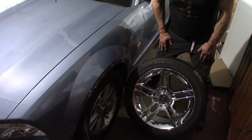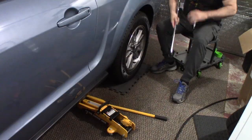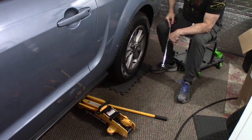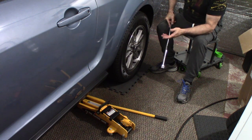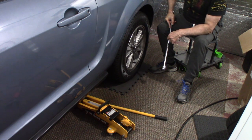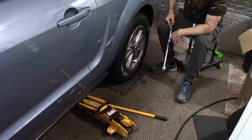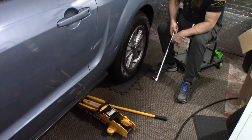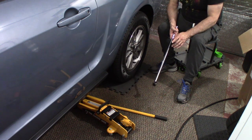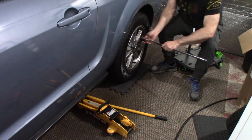So let's rearrange things and get things ready to start mounting. Okay. You probably can't see all of me, just see my feet, so pardon me. So what I'm going to do is I'm going to break the lug nuts. These lug nuts were put on awfully hard when I had the tires rotated a number of months ago. They went way over the 80 foot-pounds of torque that's required. So I do have a breaker bar with a socket on it, and really I think I learned a lesson that rather than just putting an impact wrench directly on it, probably best just to use a breaker bar